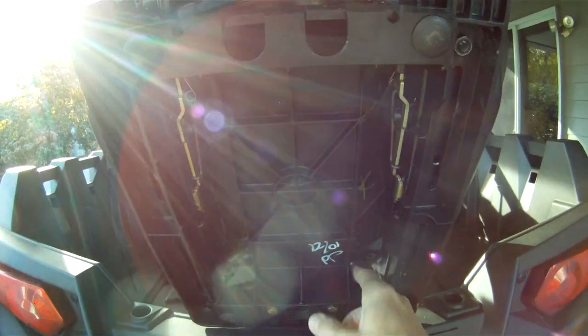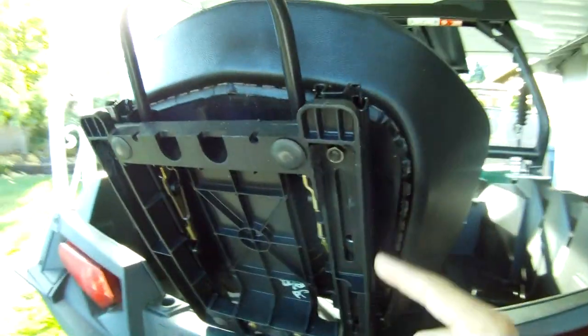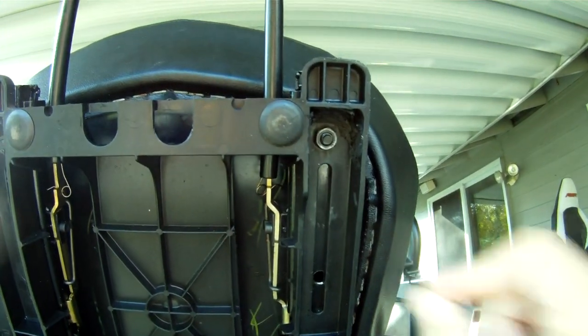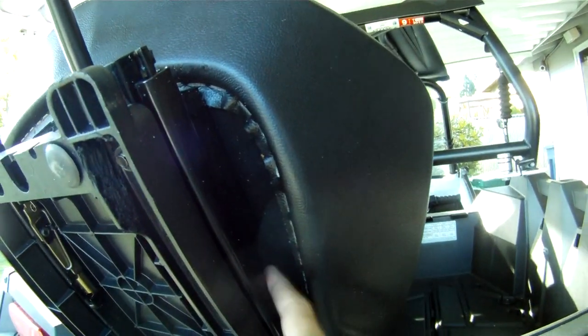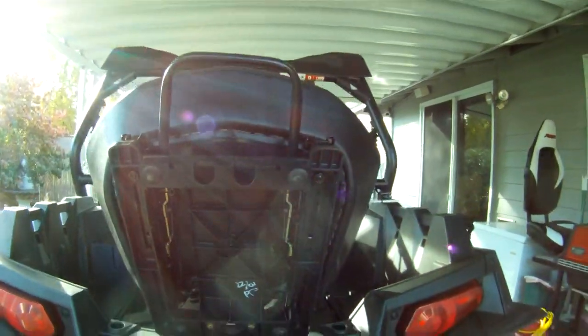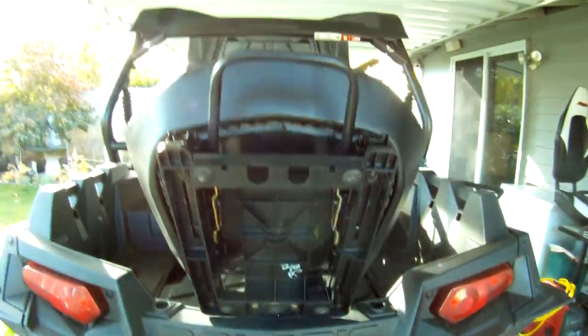Here's a look from underneath. You can see where the plastic has been cut away, but the rigidity stays — there wasn't much there anyways, just these plastic tabs, so the seat brace is still very strong. Be careful not to cut down too far like I did. There are the mounting points, and those are holes you have to drill into the base. There's the access hole I drilled for getting the screw down into the stock mounting holes on the seat itself. You do have to take that Allen screw that comes with the seat braces and grind down the head to make it smaller to fit through that hole. You could do another mounting hole on the bottom brace for extra strength if you want, but I've never found the need — the seat is very strong and very rigid.